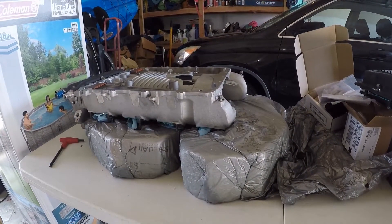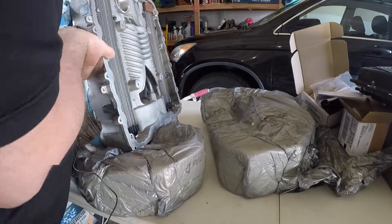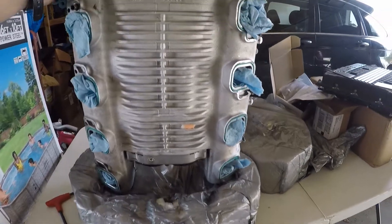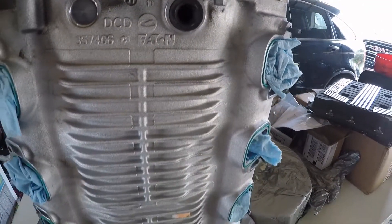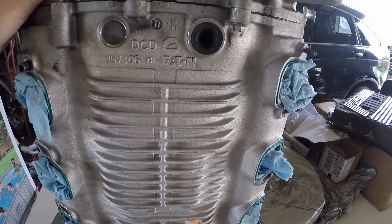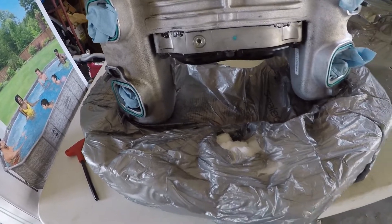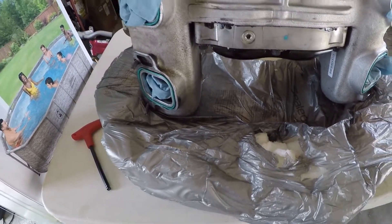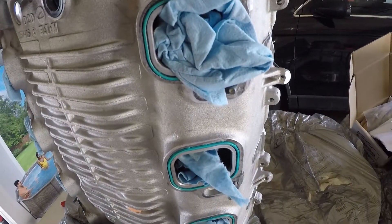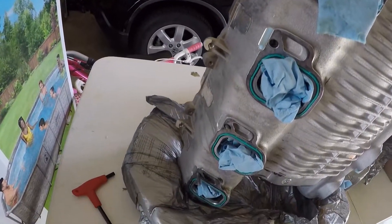Let's flip this guy up on its back end and get a look underneath — it's pretty heavy. So that's what she looks like underneath. Right there is where the PCV goes — I think I still need to get that part, a little pipe that goes in there to connect to my catch can. That little plug right there is where you drain the oil — I'll be doing that in a later video. The mating surfaces on these intake ports may need to be cleaned up, they're a bit dirty, but overall the other side of the supercharger looks to be in pretty good shape.